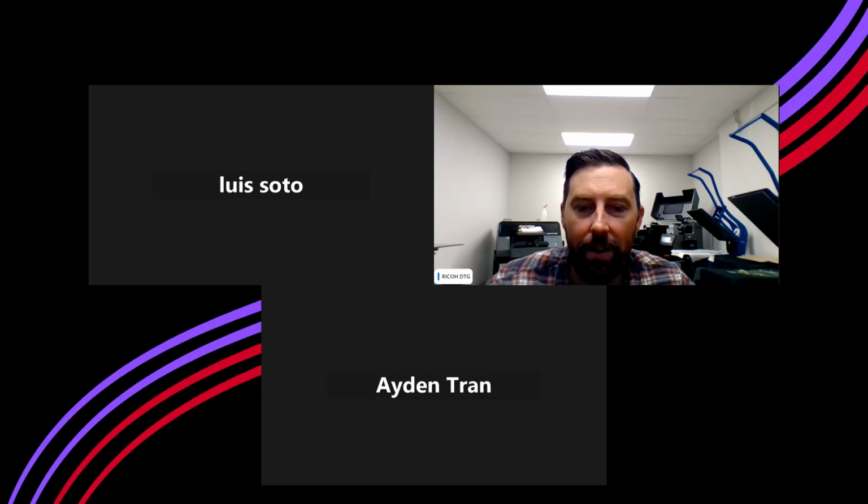Does the enhancer have recirculation like the white print heads? No, I don't think it does. I don't think it needs to. That's a good question, I can ask, but because the enhancer doesn't have pigment in it, it doesn't clog. You can't clog the enhancer.